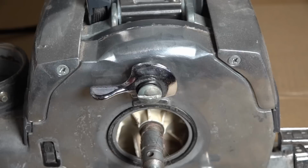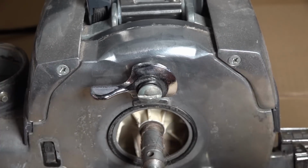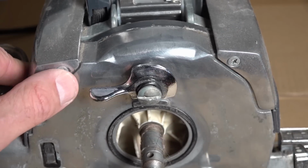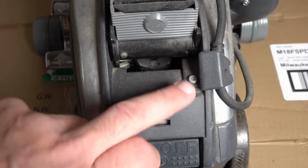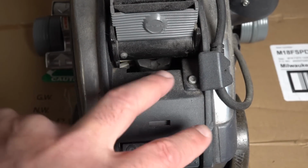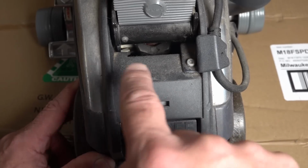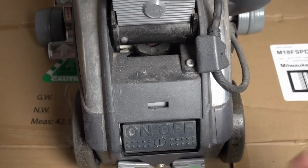So up until the G series, so the G3 up to the G4, all had Phillips screws. So you'll be removing these two screws here, which are countersunk. On the rear you should have a Phillips screw here. I've got a Torx screw there, and then you'll have two Phillips screws or Torx screws beneath this. Once you've released this screw here, just get a screwdriver right in there just to release this trim. That way we can remove this and get it all polished up.